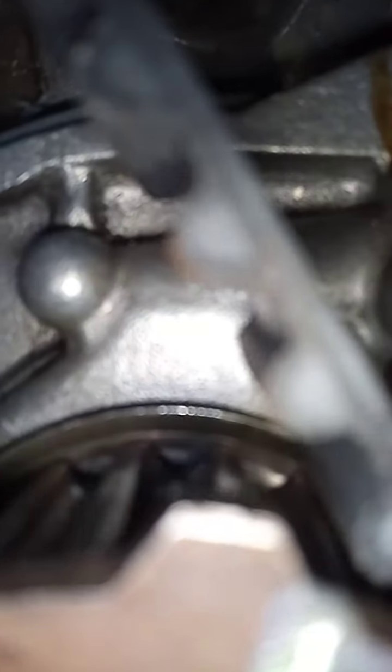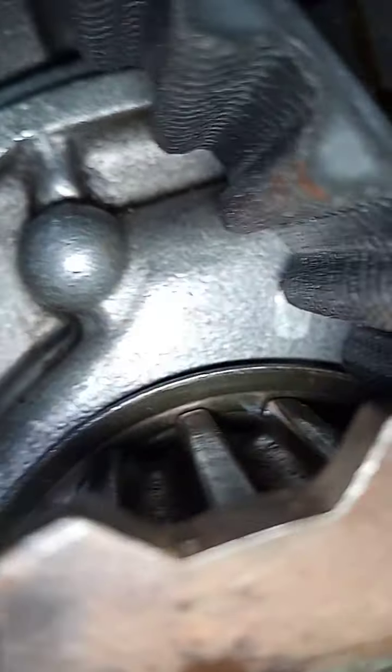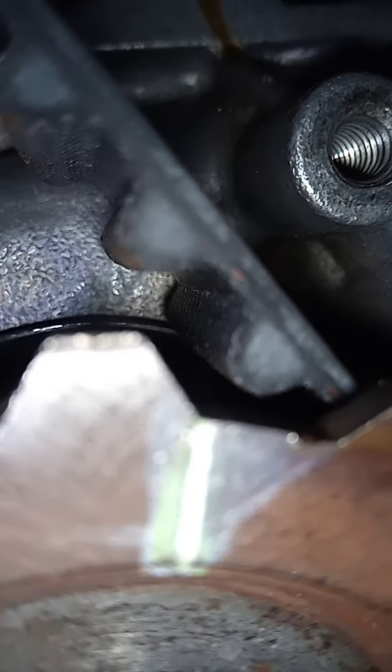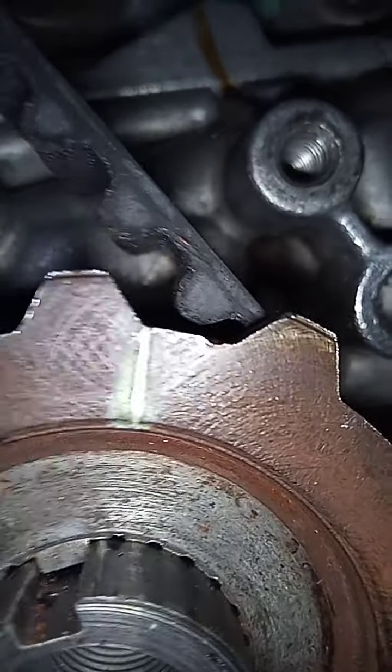If you see on the back of it, you're going to see there is an arrow. It's going to be an arrow right on the timing. You see the white mark? That's got to line up with that other mark that you see right there in the sprocket. My mark outside has got to be pointing at that. Inside, you'll see that white mark that I put — it's got to be pointing at that. As you can see, I'm right on it.